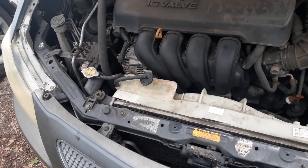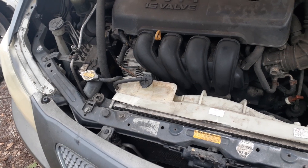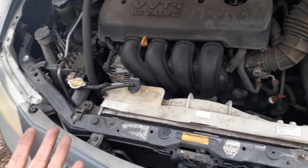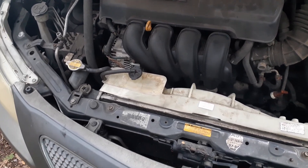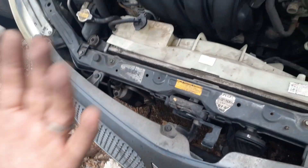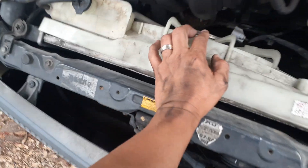The issue was it seems to run fine when you're driving, but if you're in stop-and-go traffic, or parked for a long time, or you go somewhere and stop and then go somewhere and stop to park or whatever, it tends to overheat. And the reason it was overheating was the fan itself didn't work.